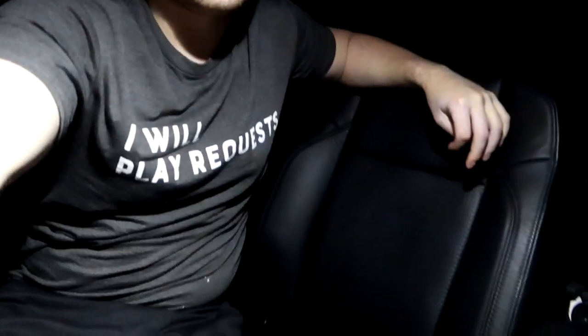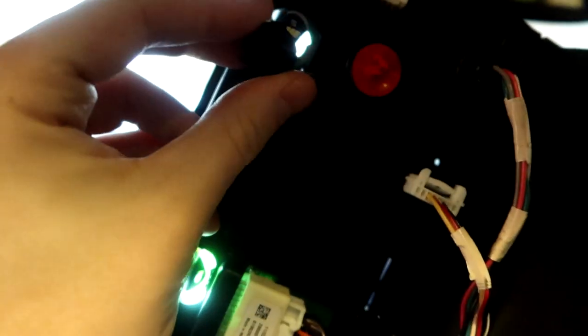With the lights turned off it's a bit clearer — the driver side with the old bulb is dimly lit, and the passenger side with the new bulb is a lot brighter. It's not a huge difference but it's definitely noticeable. Now a pro tip: if you put in the LED and it doesn't turn on, all you need to do is flip it 180 degrees. Most LEDs are one-way only. These ones I think are two-way, but if they don't turn on, flip it 180 in the socket.